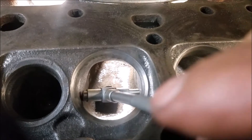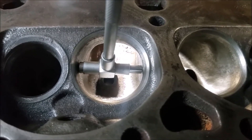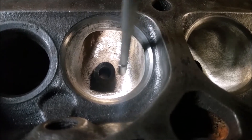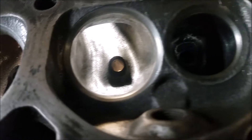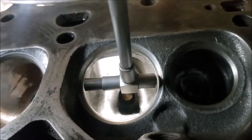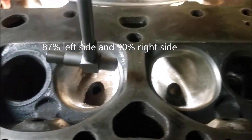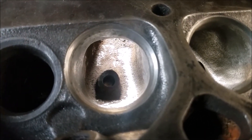There is the stock port now with some work done. This is at 1.69 inches and it's starting to go in - you could say the throat is at 87% but the bowl is not quite there yet. You take off material on this side and on this side, and the port looks so much better. On the ported head you can see how much room there is. This one is at 90% there and this is barely getting to 87%, so I'll take it to about 88%.